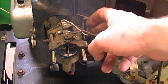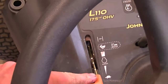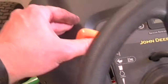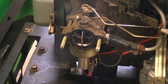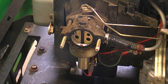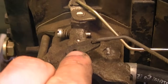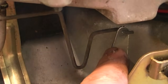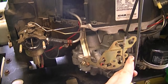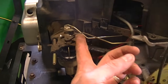This here is the choke linkage and this is the throttle linkage over here. When I set the throttle lever to the choke position, you're going to see that the butterfly will be closed over there, so I know for sure I'm talking about the right linkage. The configuration is pretty simple — there's only one hole on the choke lever, the linkage goes in and it goes down and connects at the back over here. Here's a view from a bit further off: you can see it's connected over here, it goes to the choke lever and that's it.